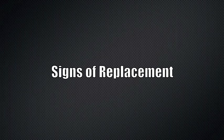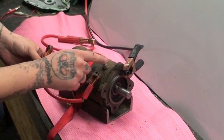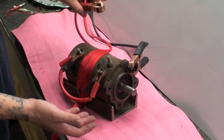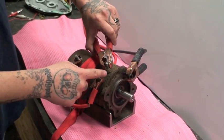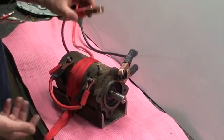In case you do have a bad motor, we'll show you what you will get from that bad motor. You will ground the case as shown before, jump from F1 or F2 to the armature, and put power to the other terminal. When you put power to it, it's either going to run sluggish, make a lot of bad sounds, or you're going to have a direct short. We put power to it and you will see that we have a direct short — it doesn't spin. As soon as you put power to it, it's very hot. This motor is bad.